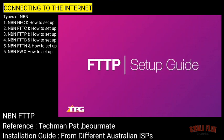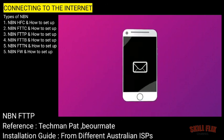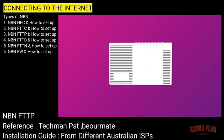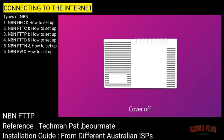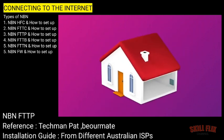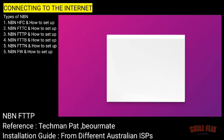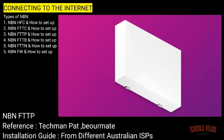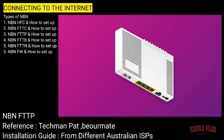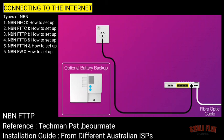Setting up NBN Fibre to the Premises is easy. Before you get started, you'll need three things: a message from us advising that your NBN service is active, your NBN modem, and your NBN connection box installed in your home. If your home has been connected to the NBN before, there may already be a connection box installed at your premises. If not, we'll arrange for a technician to come and install one. First things first, find your NBN connection box. This is most commonly installed on the inside of an outer wall of the premises, sometimes in the garage. You may need to lift the cover to see the ports and lights on your connection box. Gently prise the cover away from the two clips holding it in place at the bottom of the unit and then lift the cover upwards. Make sure that your connection box is connected to the nearby electrical outlet or to the battery backup unit if there's one in your home.